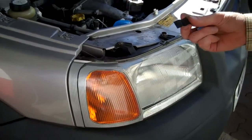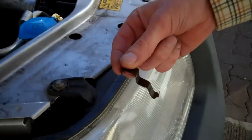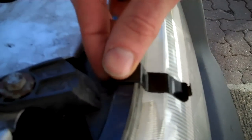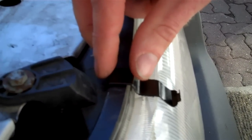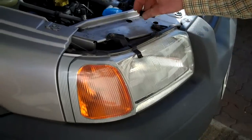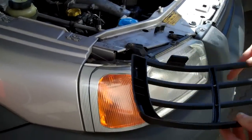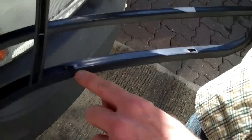The second part is there are two metal clips that clip over the top profile of the headlight. Fit the clip that's close to the indicator first and keep the other one to the side. Those clips have got hooks at the end.